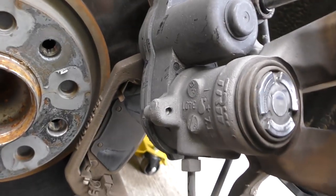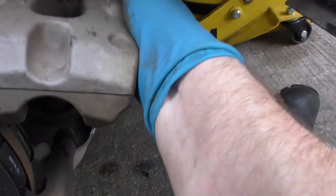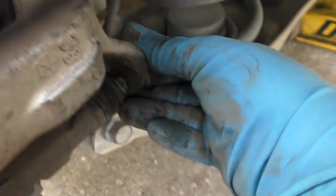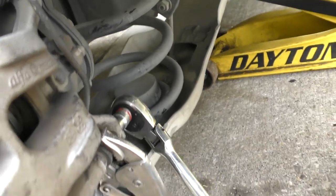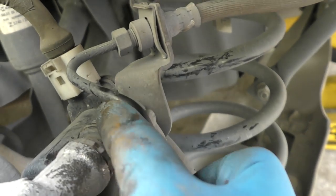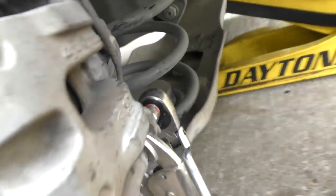So you've got to have the tool. Now that we've put new pads in and the new brake pads are on, you slide the caliper on, get the bolt, and bolt it back in place. Get it super tight. You'll notice I have a lock in place here — that's because these are so cheaply made, the little nut spins free if you try to put it tight. So you've got to tighten it with this, and then when you pull on it, it stays in place and locks.